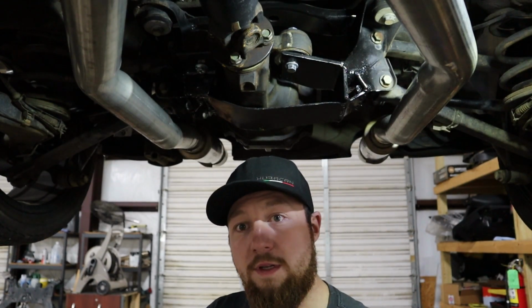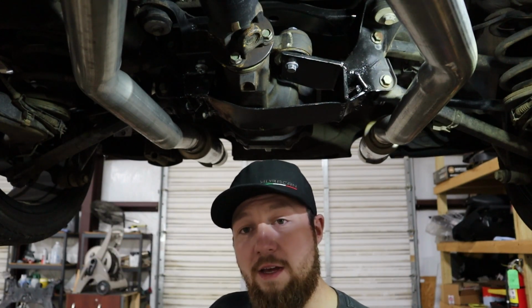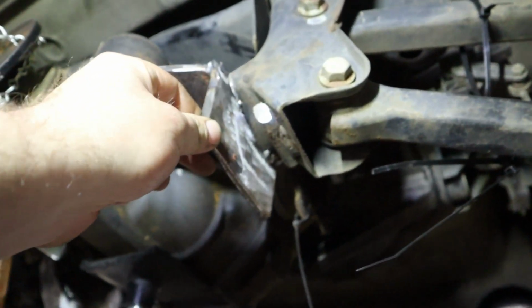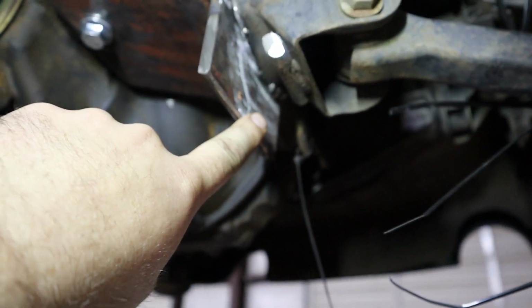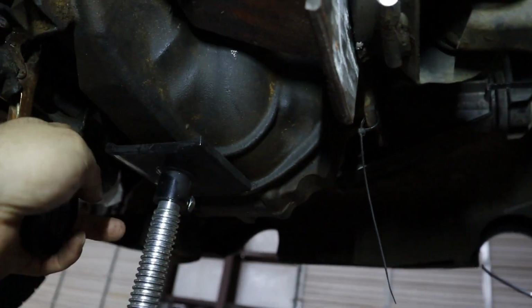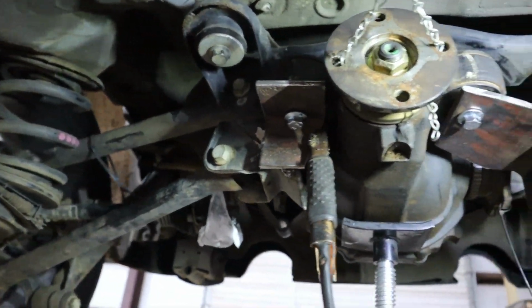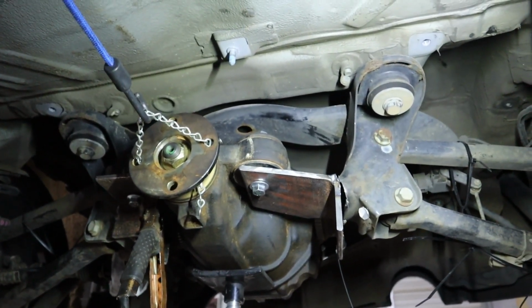And you have to think, I cut you a video in here when I was processing it, and I didn't build a tunnel or anything, and I welded it in loosely. Working on the differential right now, I make some brackets here. I left that longer because I want to also get a support from here. I had to cut out the original part that goes underneath here, so I'm gonna re-weld a piece in here again to get the stability back. That's basically what it looks like. We're gonna have to get the position right before we weld it in.